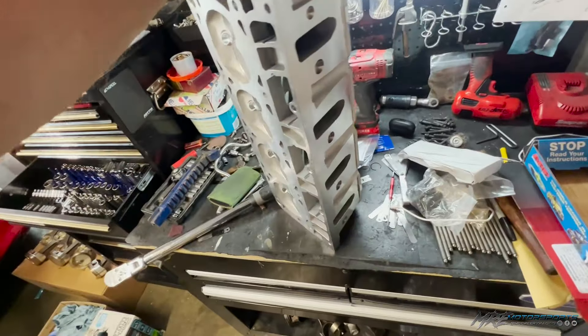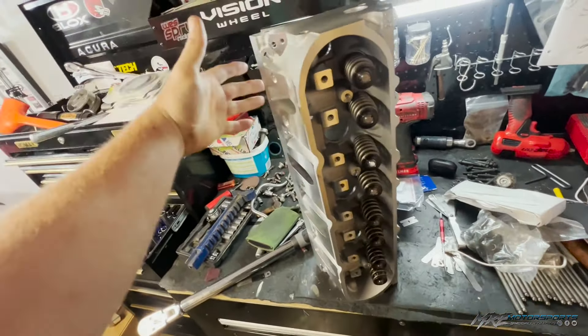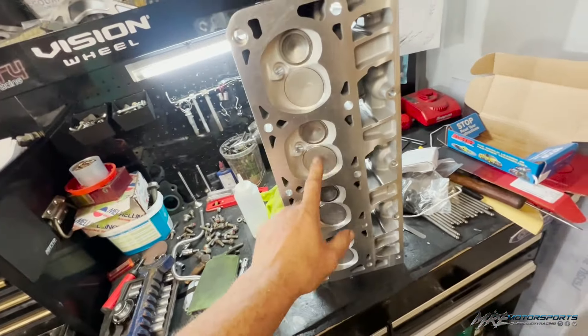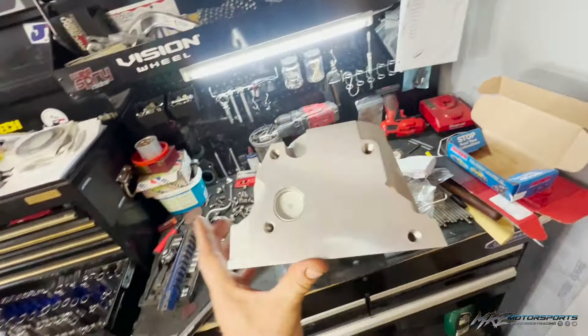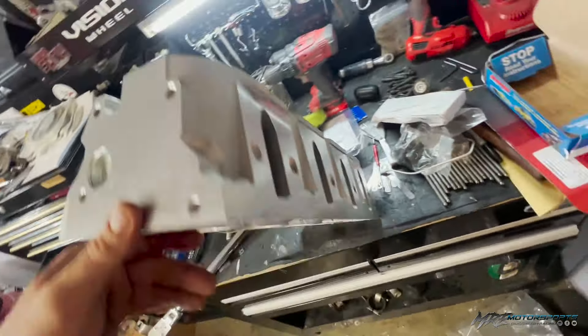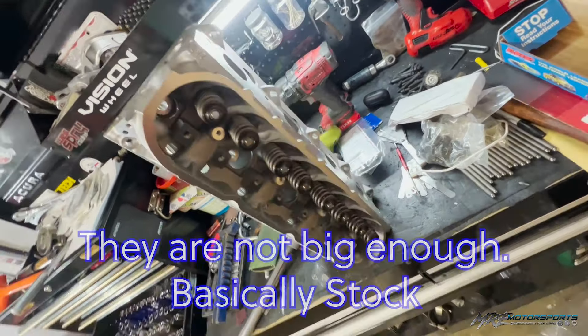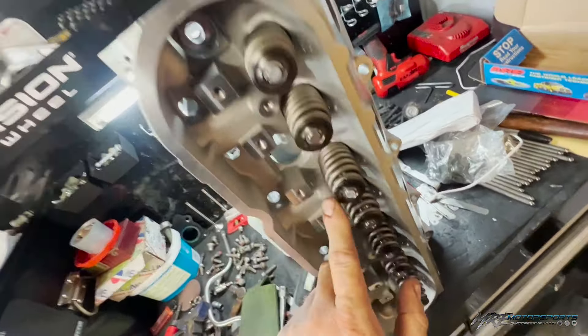This is a new casting — it's not an OEM casting. It's funny because it does say 243 on it, but it's a brand new casting. It actually feels heavier than an OEM casting to me. These are based off the 243, they've got 2-inch intake and 1.59 exhaust valves, 69cc chambers. It's basically just a brand new cast cylinder head. These are ready to go on the motor out of the box. The springs may not be big enough, but if not we'll throw some packs on it. They actually come with an aftermarket steel retainer, which looks good for the conical valve spring.